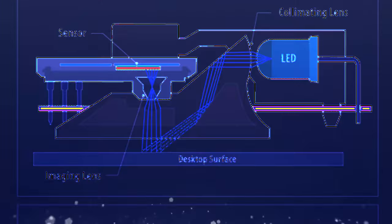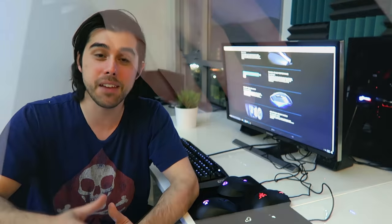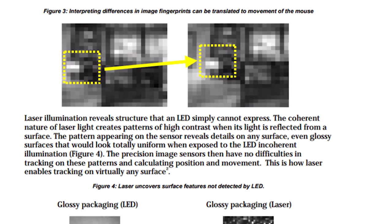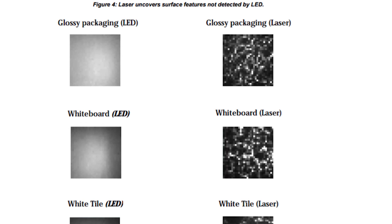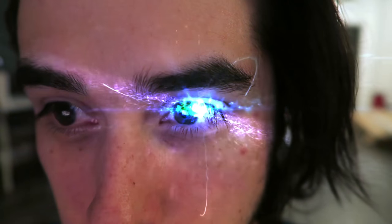These are image correlation sensors that either use laser or LED to illuminate the surface, which the sensors analyze thousands of images per second and compare those images to determine the direction and movement of your mouse. LED illumination — typically referred to as optical mice — tends to fare better on the right surface. Laser mice excel on a large variety of surfaces, but can run into problems given the laser sensitivity to the structure and fabric of the surface. The laser's wavelength and angle can over-examine the detail and depth of the tracking surface, introducing noise in the image that can lead to inaccurate tracking.